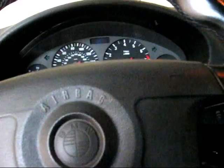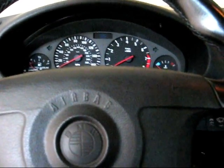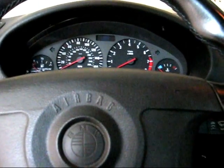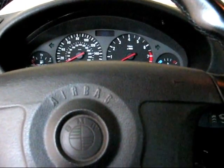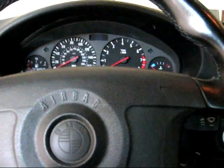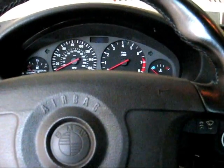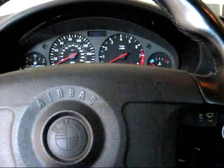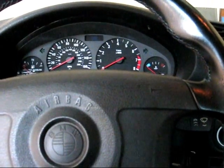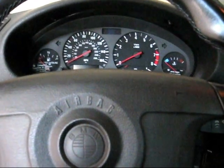So I think it's something to do with security. The car started yesterday, but it was intermittent — put the key in one time and it would start, then try ten minutes later and it wouldn't. This is not the spinning ignition tumbler problem, which is a different problem that's been covered a lot on the internet. I may do a video on that if it ever happens to this car, but it's not that problem. So now I'm going to pull a panel and try to get to this EWS antenna.